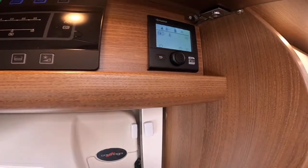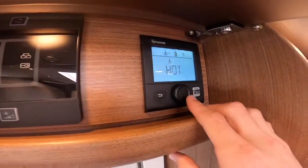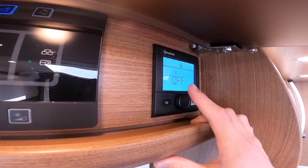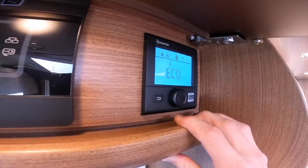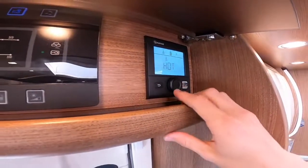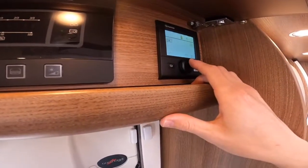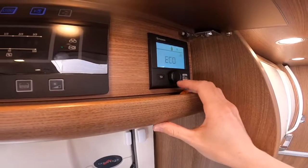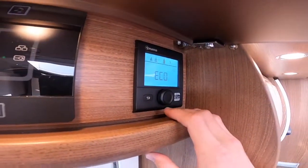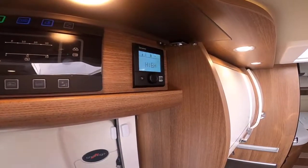Next you have a thermometer in water — this is how hot you want your water. If you haven't got any water on board, have it turned off to avoid burning the element out. You can set it to eco (40 degrees, heating the 10-litre boiler) or hot (60 degrees). It's gas only so you can't choose the source. Then you've got your fan — a 12-volt assisted fan. Eco is slightly quieter and takes a smaller draw from the leisure battery, or set it to high if you're in a cold van to distribute heat throughout the vehicle.